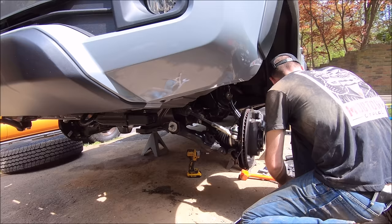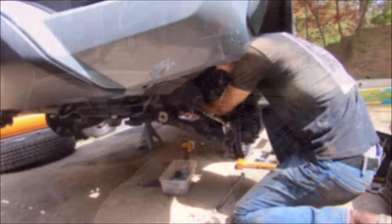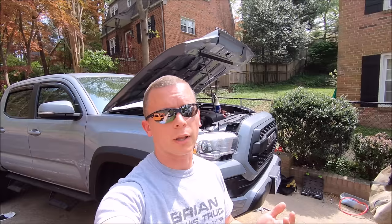For the last step, open up the fill plug on the front differential to see if any oil needs to be added. If a little oil dribbles out of the fill plug, you're good. Otherwise, pump some in until it barely starts to dribble out of the fill plug — and that is it for the install. That was the installation of the ECGS clamshell bushing on a third gen Tacoma — very similar if not identical process for the second gen Tacoma. Hopefully you found this video helpful. If it was, comment below and give it a thumbs up. Thank you so much for supporting the channel and I'll see you in the next video.